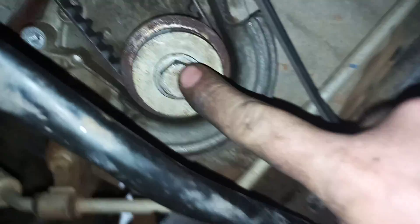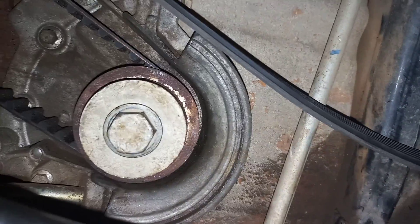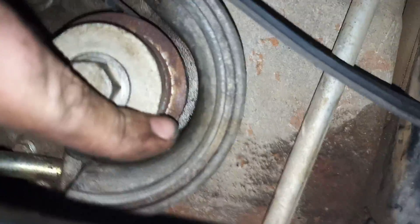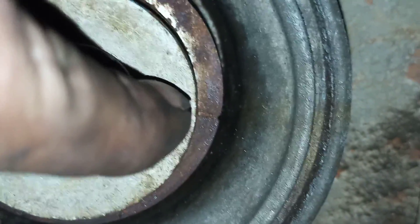At the bottom, on the crankshaft, you will have the marker here — I've already put this bolt on there which you need to take off. You should have a marking here somewhere, but as you can see there's nothing there — absolutely nothing. There's just a little line, very hard to see because it's a little bit rusted, but I can see it right there in the center.